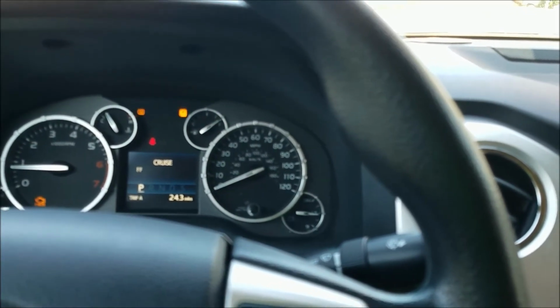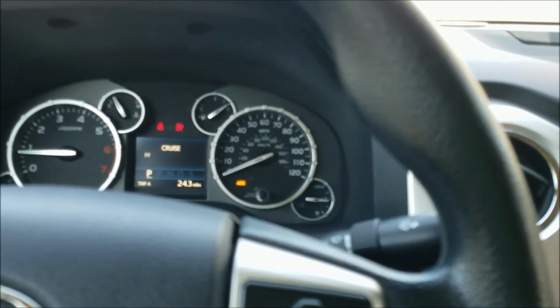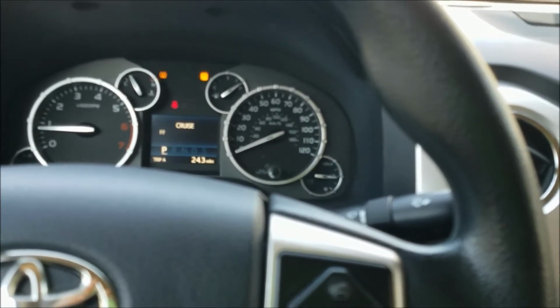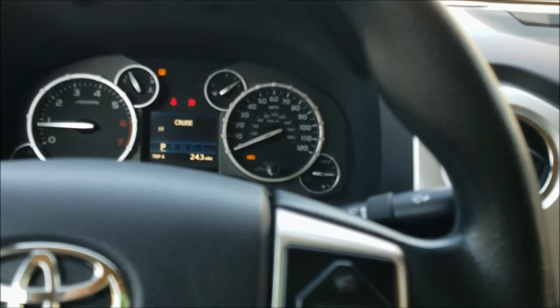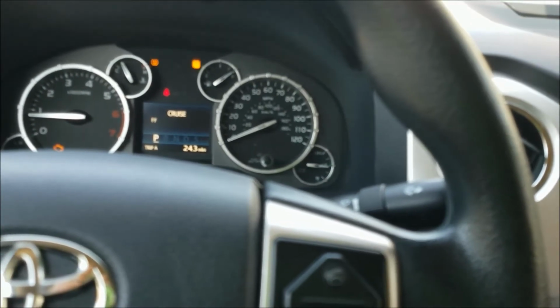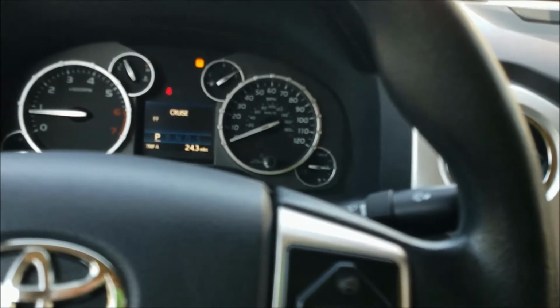And then you can put the plug back in and torque it correctly. They'll tell you, in the instructions, to use a new washer. It's a crush washer in this application, but in my entire life of changing oil in cars, including transmission fluid, I've never changed the washer except when I did this transmission fluid change a few days ago. And I've never had a leak. And when you think about it, a crush washer, after it's crushed, is just a crushed washer. And there's no reason, in my opinion, to replace it. But, you know, it depends on who you are.